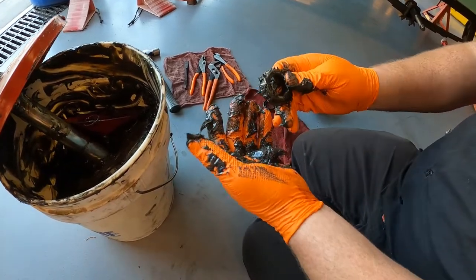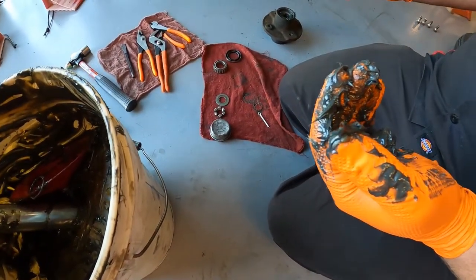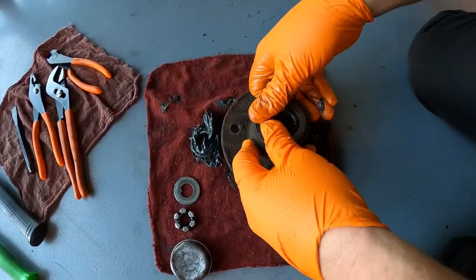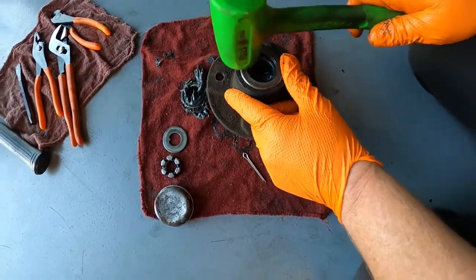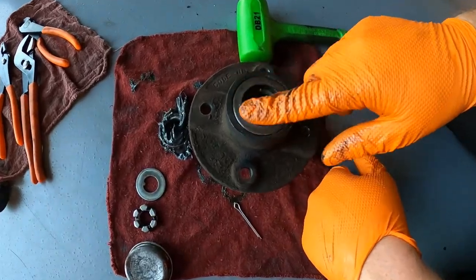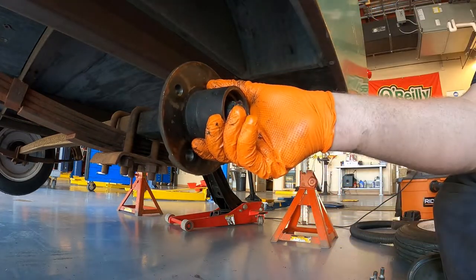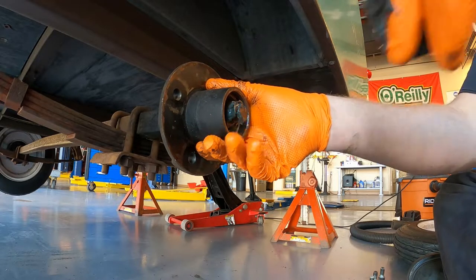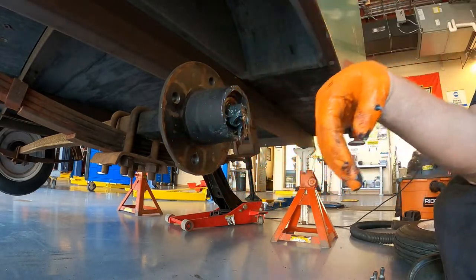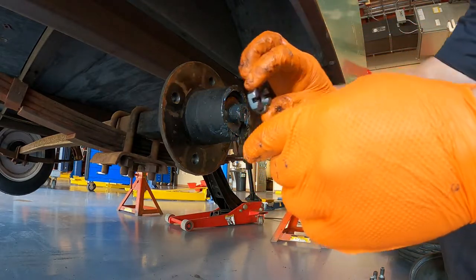It's important to make sure we kept everything in order. This is our rear bearing, so I'll drop it straight down into the hub assembly. We can then put the seal back on and pack the next bearing, then set everything else up. We're going to install our dust shield - put it in by hand and use a light rubber mallet to tap it into place. The seal just needs to be flush with the end of the housing. From here, we install the hub onto the spindle end of the axle, then take our outer bearing and place it inside with the taper going towards the middle. We'll then put our washer - it has to line up with the groove on this application - and then put on our nut.